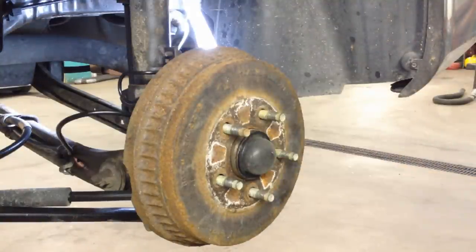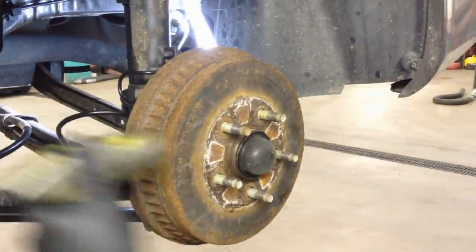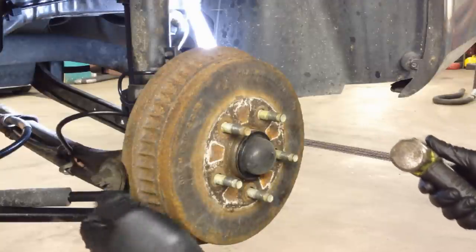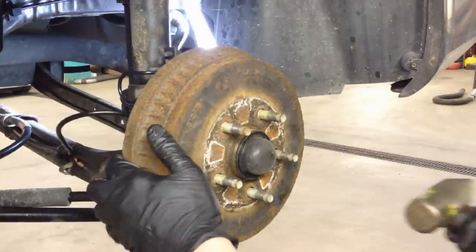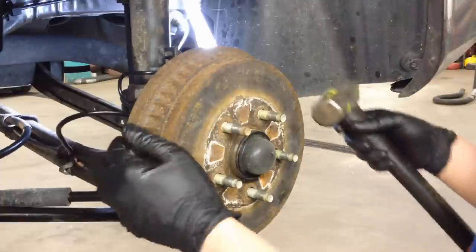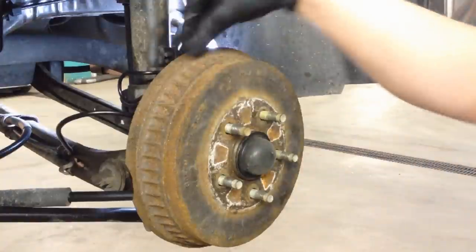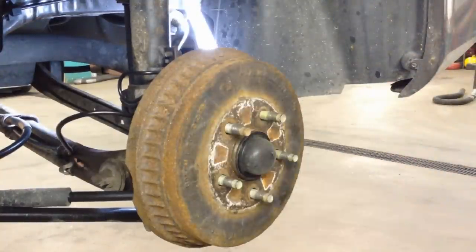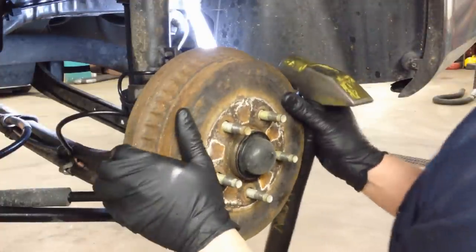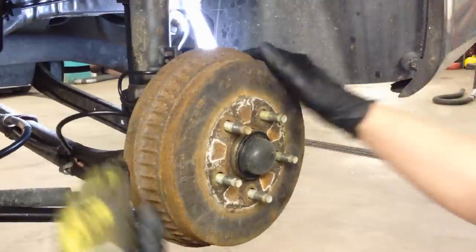First, beat the front of it a little bit to break the bond from the hub if there is one, then start tapping from the sides on both sides. While you're tapping on one side, you're pulling on the other side with your hand or a small pry bar. What you'll start doing is breaking that rust ridge and working a pass through with the hammer effect instead of just yanking, and it will come past. Just remember to do it evenly.